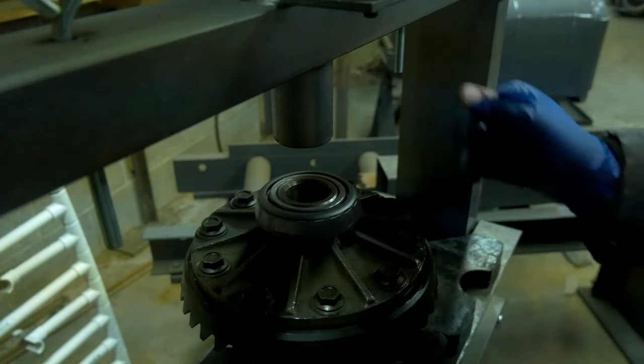The reason I go to the 137, the minimum torque spec, is because if I'm low on the pinion preload, meaning the pinion preload is just under what the spec calls for, then I can always tighten that nut up. If I go too tight, it's really hard to loosen everything up, because you've driven the bearings further on the shaft than where they would have been. So I don't really know if that makes sense. If it doesn't, maybe drop a comment and I'll explain.